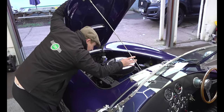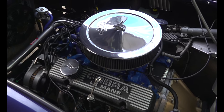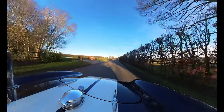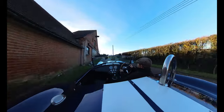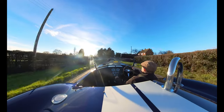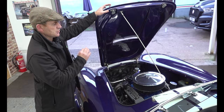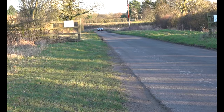When you look under the bonnet of this car, you'll see it's fitted with the lightweight aluminium Rover V8. Most of us in the trade who know cobras and buy and sell lots of them find that, to actually drive around British country lanes, the lighter smaller aluminium V8s give you a much nicer, easier driving car. They're much more balanced - the engine is no heavier than a two-litre Sierra engine. Being an aluminium block means lighter steering, lighter clutch, and a much nicer balanced car for pushing around corners. This particular Rover is a 4.1 litre with quite a good spec, producing brilliant power, and in the nice solid rigid Southern Roadcraft chassis it's a really good car.